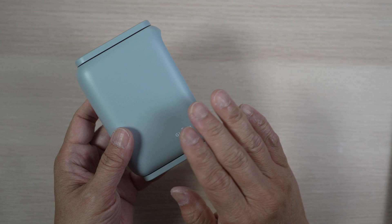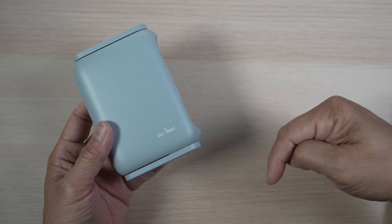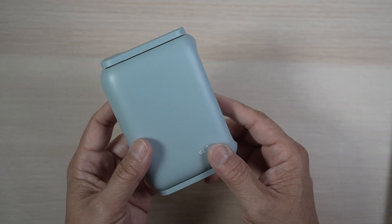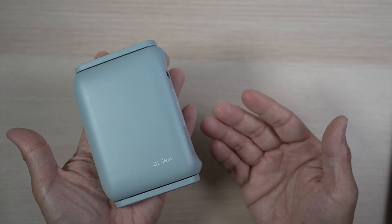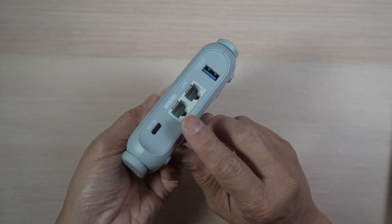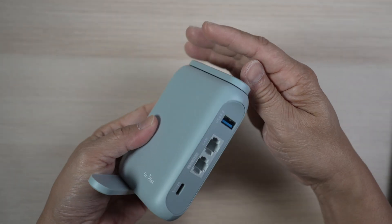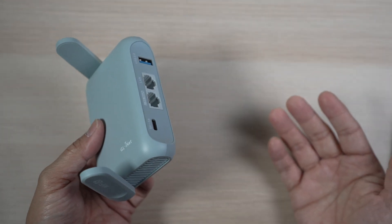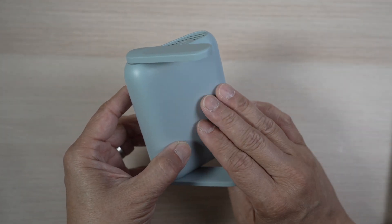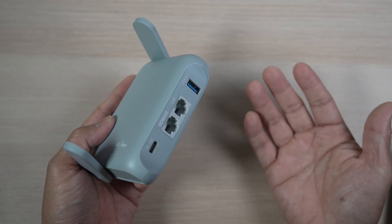For just $120, the Beryl AX is really a little giant. There are additional discounts often in the link I'll put in the description below — there's a $20 off coupon currently, for example. The Beryl AX is small, perfect for traveling far or a trip to the cafe, and it's packed with features such as Wi-Fi 6, 2.5-gigabit Ethernet, VPN, WireGuard, and AdGuard. Its antennas may not be powerful enough to reach every corner of a huge house, but it's more than adequate for a hotel room or a small Airbnb. This little router is so packed with features and so convenient that I use it at home as a secondary router too.